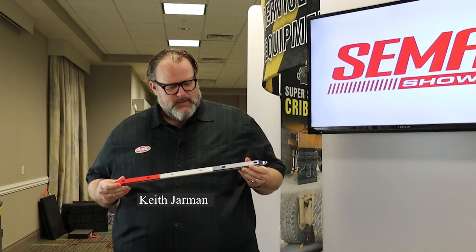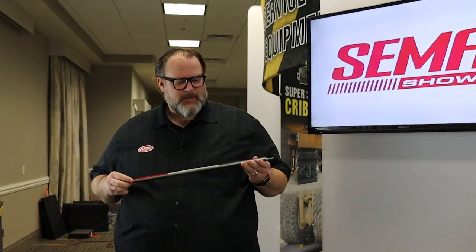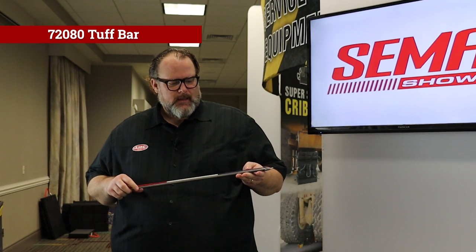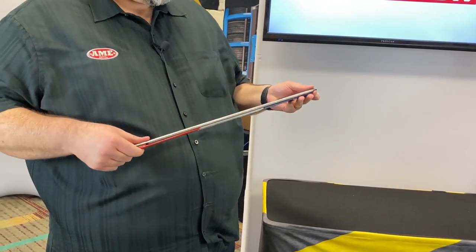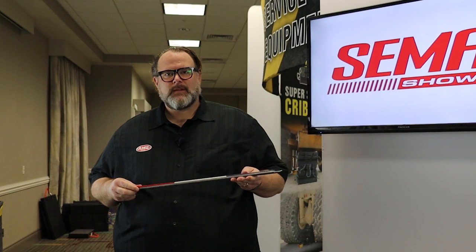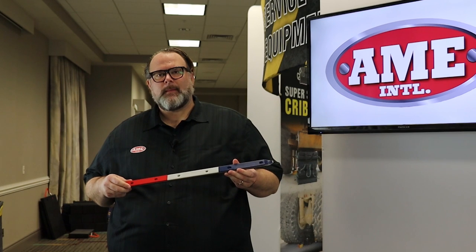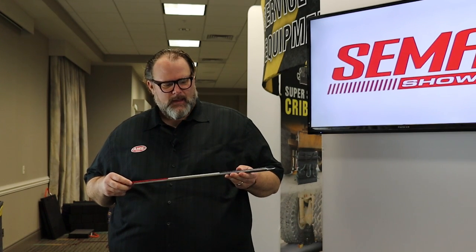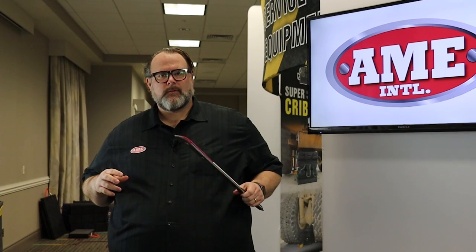Rounding out our automotive items — this isn't necessarily new, but we did just make an acquisition of Plastic Component Design, who had engineered and developed some accessories. This particular one replaces your standard 20-inch lever and is designed for use on mag or aluminum wheels, so it will not mar anything when using a rim-clamp tire machine. It's called the Tough Bar, and now produced by AME, it's a great accessory for your tire machine.